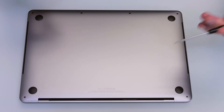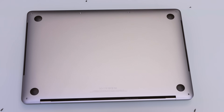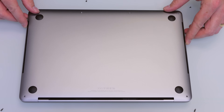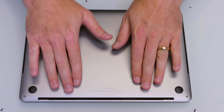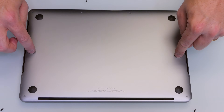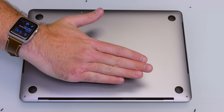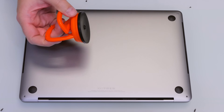To get in, you just unscrew each screw. The reason for the video is it's actually kind of hard to get into a MacBook Pro 2016. It has little butterfly or winged clips up front that hold it in place, and two clips here and two clips here underneath, so it makes it seem very hard to get out. What you essentially have to do is scoot down the plate and then lift it up — and that's what the suction cup is for.